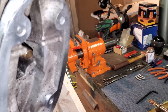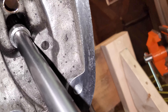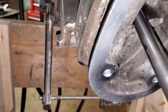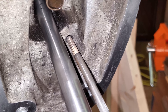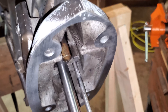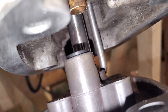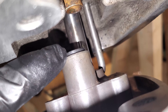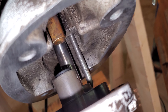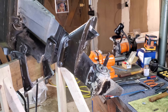I'm pretty certain I can do this with one hand - we're about to find out. The drive shaft goes right up in there, and the shift linkage needs to come up and right into the hole. Once you get those two things lined up properly, you should be able to slide in pretty easily. Now you can see the seal on top of the water pump - right here - this is the seal that's going to need to slide over the water tube that we just put some oil on. And this is what we look like with the lower unit assembled onto the motor leg.